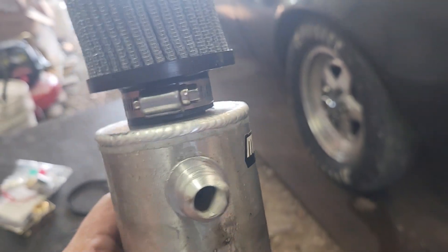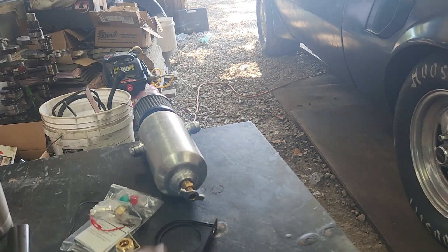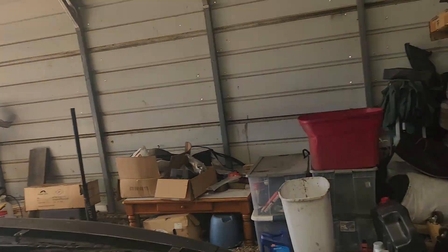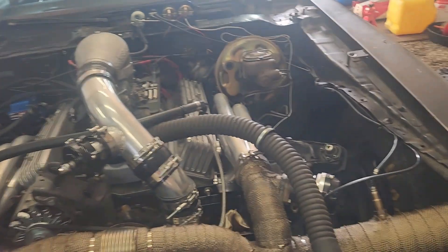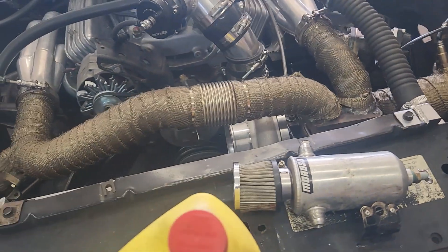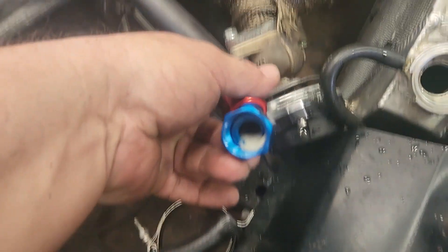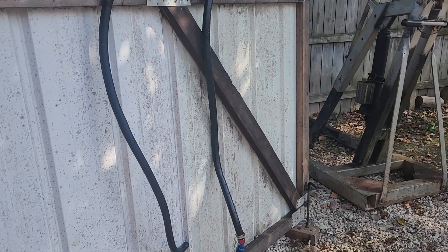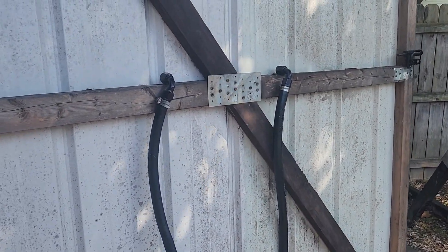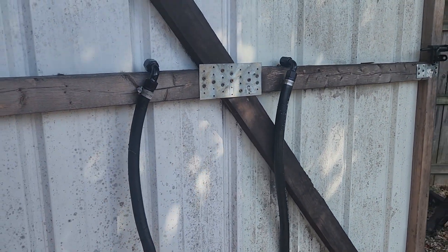See, this catch can is filthy from where it got water in the oil — there's a big mesh thing in there and it just gets all stuck up in it. I'll clean that one out but I'm just gonna put mine on it for now because mine is bone dry — I opened it up and there wasn't even anything in it. I wound up taking the hoses off for the catch can and sprayed carburetor cleaner through them, got a lot of it out, then hooked them up to a water hose and shot water through. I just let them hang and dry.